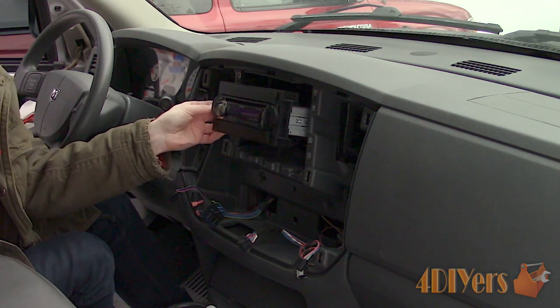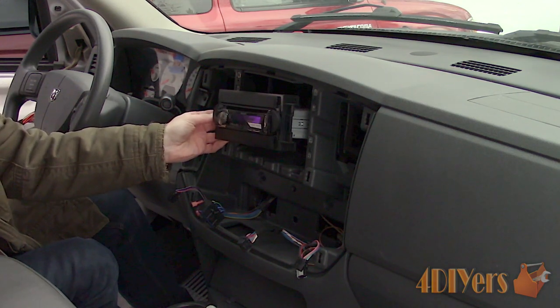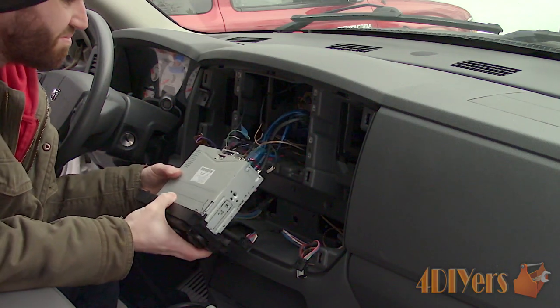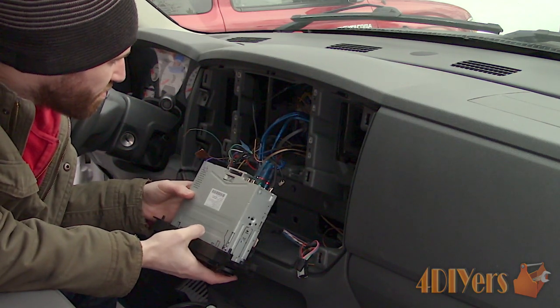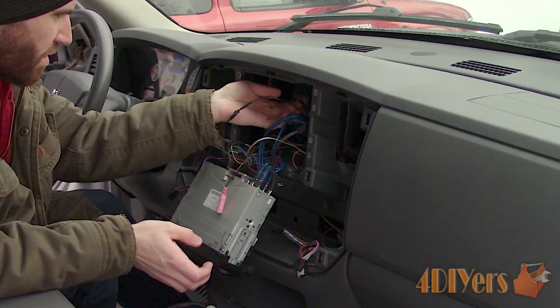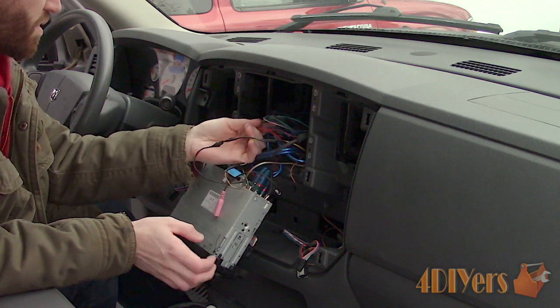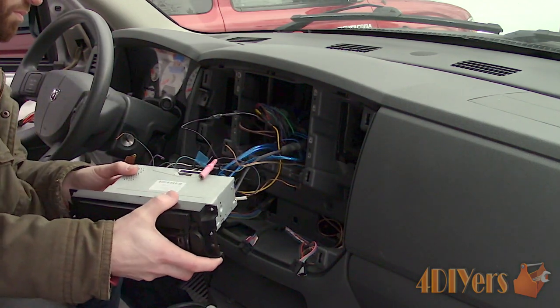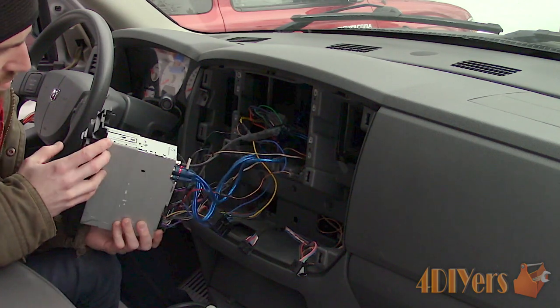While I'm redoing the audio system in my truck, I am having to sort out which wire does what. Typically black was the standard choice for North American and Asian vehicles for negative. European vehicles would use black as a positive wire instead, and brown would be used as a negative wire color. But that has changed over the years due to standardization and more complexity of electrical systems.